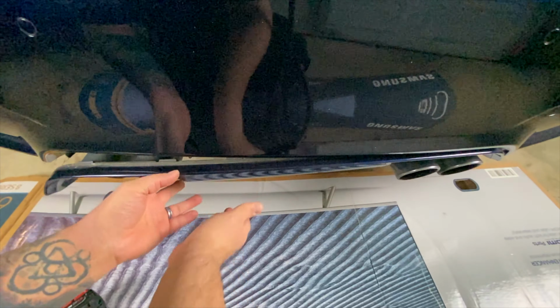Just get the hole, and once you get the screw in there, push up so that it indents into the plastic and doesn't walk. Make sure your edge is good, and then start going. You'll feel it once the self-tapping part pops through, and then you'll feel it grab with threads.